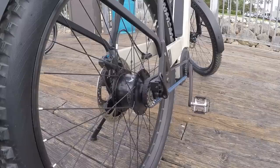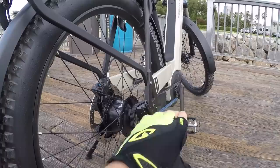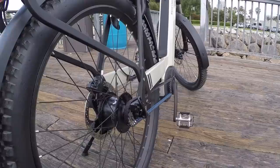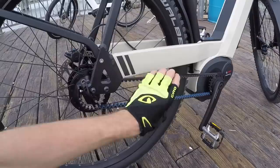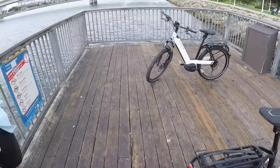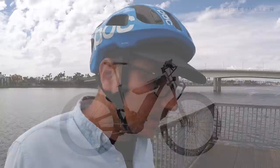Something very durable — you can see there's no derailleur hanging down, no cassette, and there's room for a belt drive which is clean, quiet, and more reliable than a chain. This one has the CDX, a center-track design that won't fall off and brings everything in closer. Mueller has done a great job with their frame designs — the belt runs below the chain stay, a combined seat stay and chain stay, versus other frames that require a physical cut to fit a belt. They also have a chain-driven bike with the Rohloff as well.